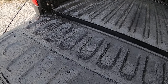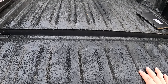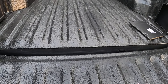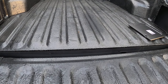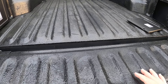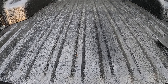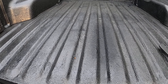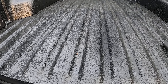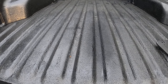Because this stuff is so sticky, you don't really have to prep the metal surface very much. A scotch-bright pad is more than enough — anything mildly abrasive will give you plenty of adhesion since this will stick to pretty much anything. Within about five hours out in the sun, it was pretty much dry, or dry enough to put a second coat on.